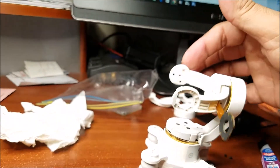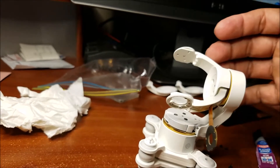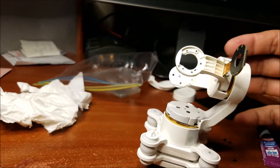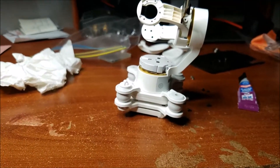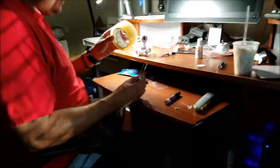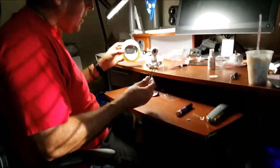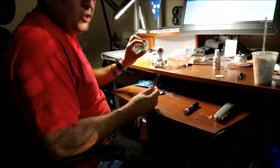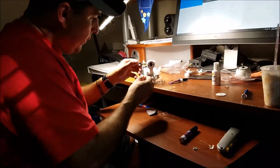I just replaced the ribbon cable and so far it's moving real good. I think if I did it, you guys can do it — it's not easy. The only thing you gotta watch out is your screws, make sure everything is in place. This is the arm — I got box tape and the reason I'm using this is because the original little tape is losing the ability to hold this piece together, and using this kind of tape is gonna work real good.